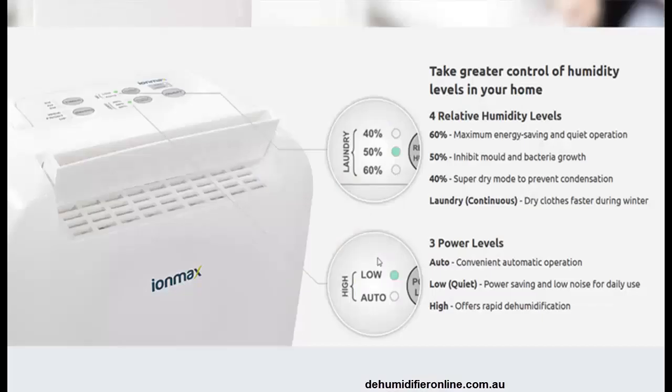It allows you to control the humidity level in the home. So you can set it to, say, 50%. Now the normal humidity that people recommend is 50 to 55%. So getting it to 50%, you're going to stop the growth of the mold and the bacteria in the room or in the house. You can run it to 60%, which is energy saving, so you're not going to keep running all the time, because once it reaches the humidity level that you specify, then it will stop dehumidifying. So you don't really want to dry it out too much. But if you do want to dry it further, you can get down to 40%.